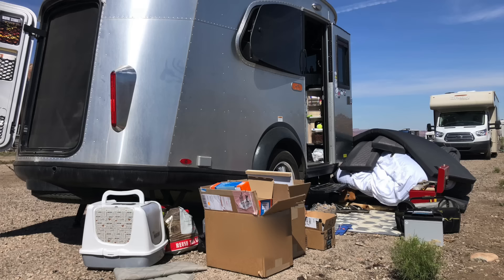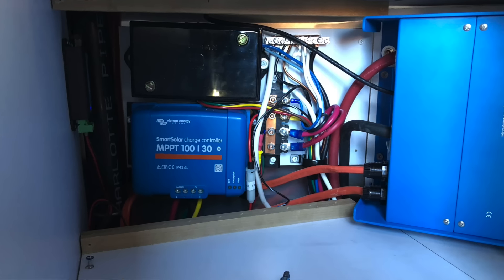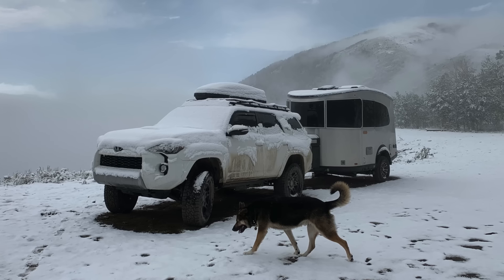I was in the market for new batteries anyway, and a friend offered to install them, so the stars aligned and I ended up going lithium. I also got a 2,000-watt inverter, a Victron solar controller and battery monitor, and upgraded all of the electrical. That is the best thing I ever did for the Base Camp in terms of boondocking capability. I can now go four to five days during cloudy weather without even thinking about it on the lithium batteries. With the AGMs, there were mornings after just one cloudy day where I'd have to rush to an RV park to charge everything up so I could work. With the lithiums, I've only had to do that once — when snow piled up on the roof in Colorado and I couldn't clean the panels off.